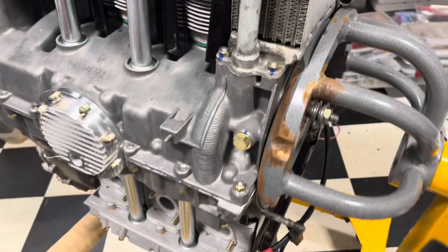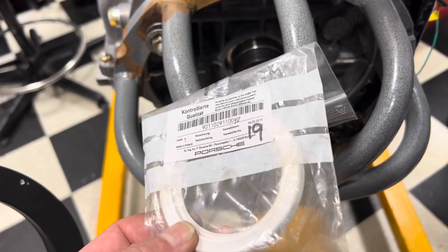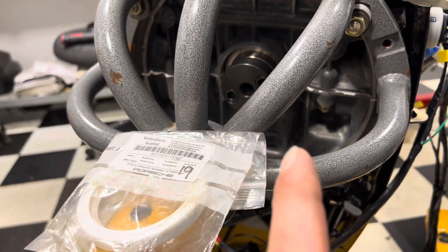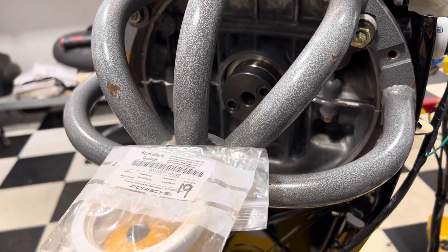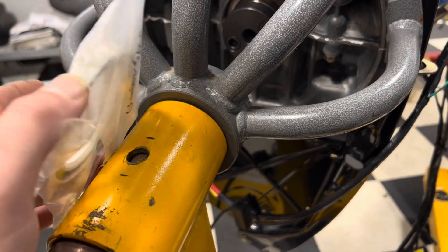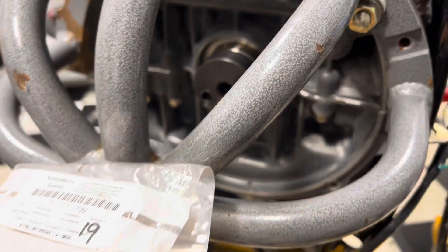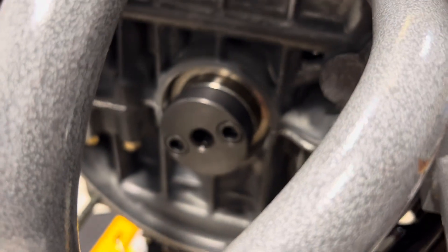The next step is we're going to install our rear main seal. We've got this very fancy white rear main seal from Porsche. Rear main seals are like the bane of existence for air-cooled motors. We didn't need a speedy sleeve — the crank wasn't that worn. But after talking to my machinist, he had a great idea. He said these are the ones that work the best, so we're going to give this a shot. I've already got my tool installed partially on there and everything's been super cleaned.